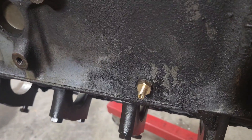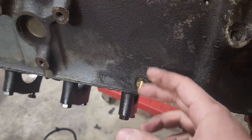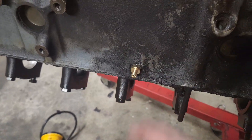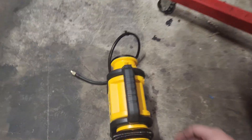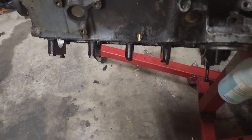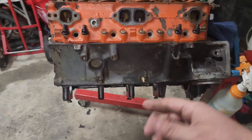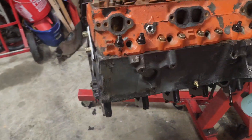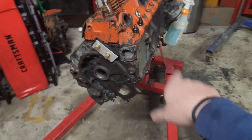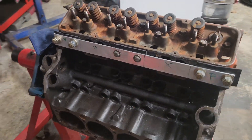I have these little aluminum block-off plates with a little piece of rubber on the water pump port, and anywhere the coolant will flow through the head — same deal. I got a couple of bolts, a half-inch nut and a washer just to spread the load, and a little bit of rubber. The real magic is this coolant drain port right here. There's usually just a block-off fitting here. This is a quarter MPT to a tire fill adapter. I'm going to use my DeWalt tire inflator, but for what I'm showing today, you don't need this fancy gizmo — if you have a bike pump, you can do the same exact thing.